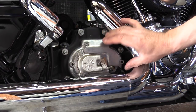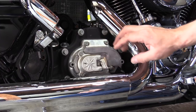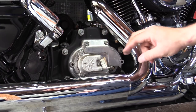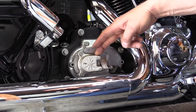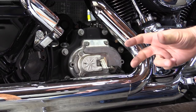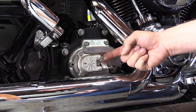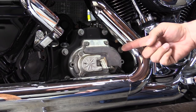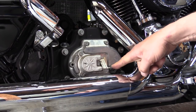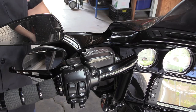Once we get the outer side cover off, that gets us down to our secondary clutch actuator, which is this piece right here. We're going to do this a little differently than bleeding brakes — we're going to push bleed this. We're going to put a syringe onto our bleed valve here and push fluid through the line. This is the line that goes up to the master cylinder.